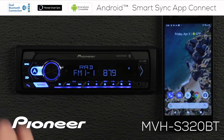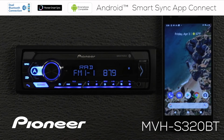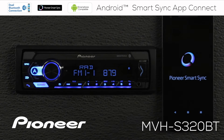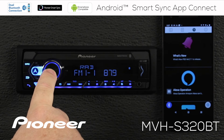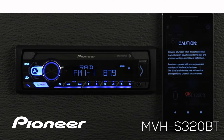In this case, I have my phone connected through Bluetooth, but the Pioneer SmartSync app is not connected, so I'm going to force the connection. I'm going to start the SmartSync app on my phone. The connection didn't automatically happen, so we're going to force it by pressing and holding the volume control for a few seconds. That will create the connection between the in-dash receiver and the phone. We'll say OK to the caution screen.